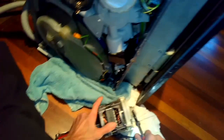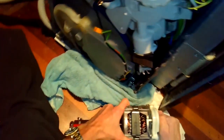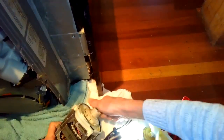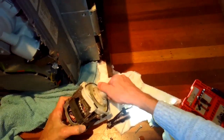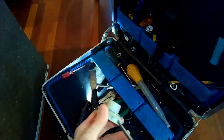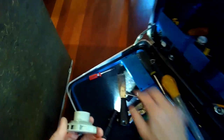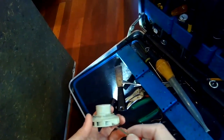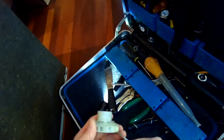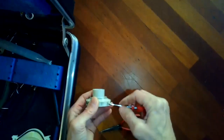I'm going to stick a standard head screwdriver in the back of the motor to hold everything from moving, grab the impeller, and turn it — instead of righty-tighty, it's going to be righty-loosey. This is a reverse thread; so turning right loosens it. I'll spin it off by hand. Now I'm pulling out a little piece of junk caught in the impeller. The customer accidentally had their filter loose, so some junk got sucked in — just one vane was clogged, probably reducing efficiency by about 10%, but that can be enough to cause an F14 error.